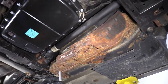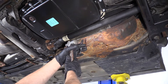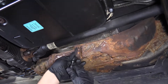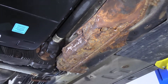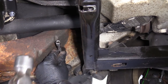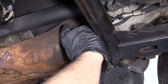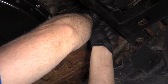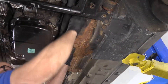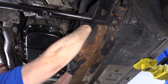This is a cover that's going to cover the fuel filter. I'm going to take an eight millimeter socket and take this screw out. I'll just use a hammer and tap it — it's a little bit rusty. Loosen this up, take that down, and there are two fasteners right here. Just use the eight millimeter socket with an extension and tap those, then take the ratchet and take these off. I'm going to hold the shield with my other hand, take that one off, grab the shield, slide it out, and pull it down.